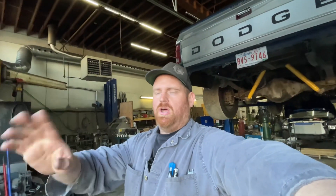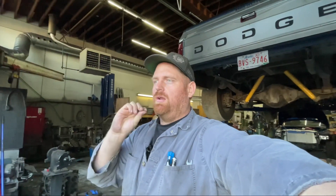I got some video of doing the towing, but no actual commentary on the video. Truck tows way better than it did before. I'm going to put a tighter exhaust housing on this turbo, the S476, because I would like it to spool a little bit harder.